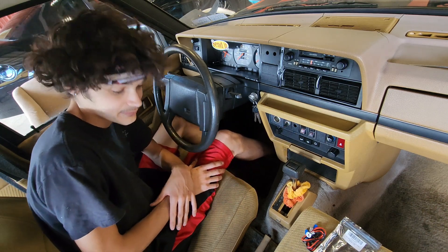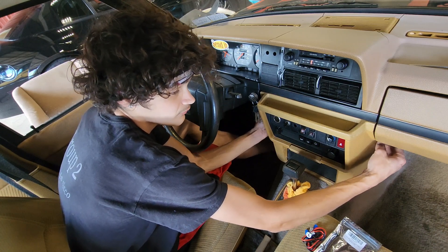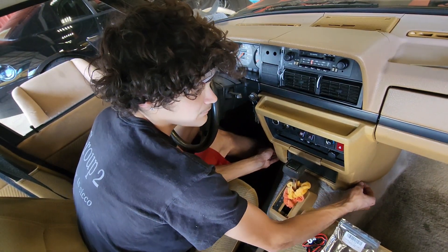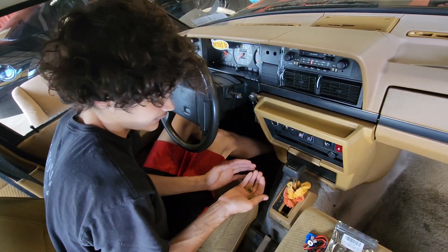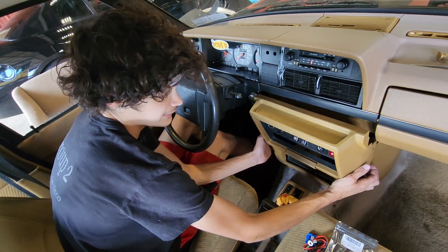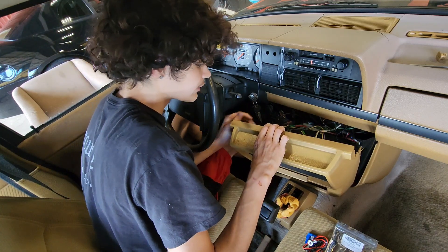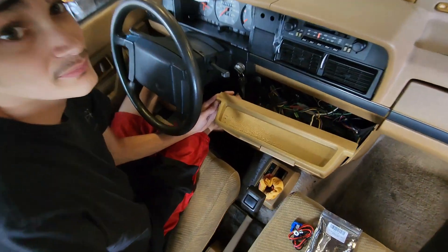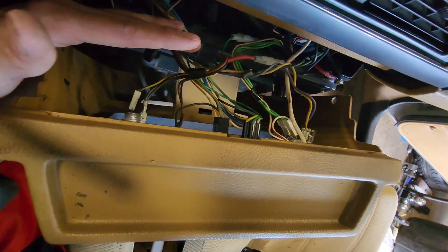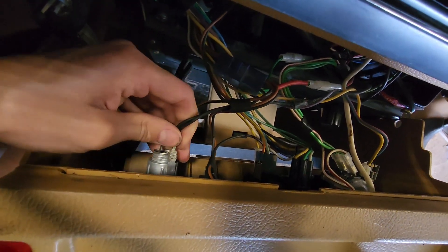If you have a 240 it's a pretty easy one. I'll start off by taking off this faceplate here — I already have the bolts loosened. Take out those Phillips and flat heads on the sides, plastic trim tie-down pins. Pull the faceplate out a little bit and you'll see there are just two little spade connectors on the back of the cigarette lighter, with a whole harness back there for all your plugs.